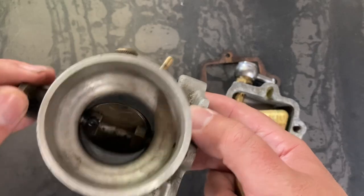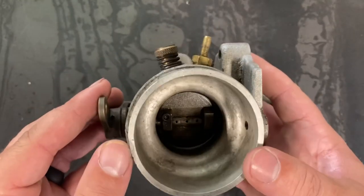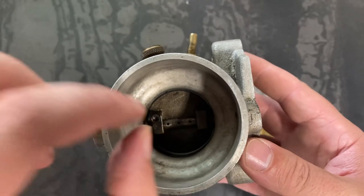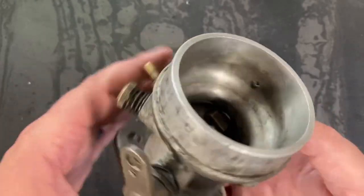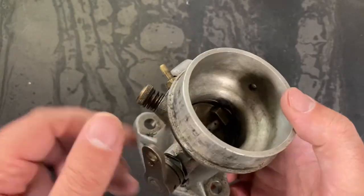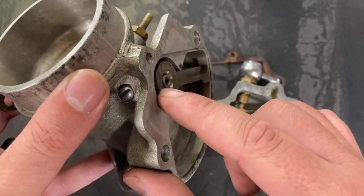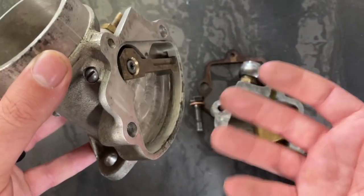All that pressurized fuel gets forced up the arm much more aggressively than the normal metering section, compensating for the big rush of air entering the venturi. There are some adjustments to be made: an Allen head screw on the left-hand side acts as a clamp of the butterfly onto that shaft, so you loosen it and physically move the plate to roughly set your idle. There's an air bleed on the left-hand side that reroutes some air past the plate in a closed scenario for precision adjustment. There's also a secondary metering valve at the 90-degree turn from the arm to the shaft — you can open or close that orifice to increase or decrease the amount of fuel.